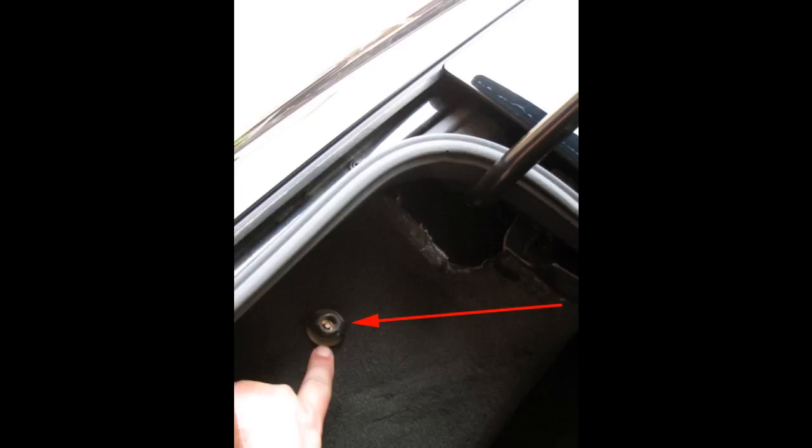And all along the way through the trunk here, you will have seen a factory wiring harness running through there with some factory installed places where the wires are run and held down. Whenever possible, I try to either zip tie to these or follow the channels and add my wires to them. It just makes the install cleaner, and makes sure your wires aren't getting in the way of moving parts that you're not fully aware of.